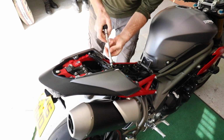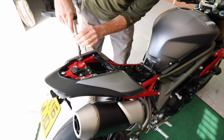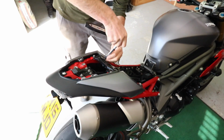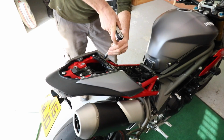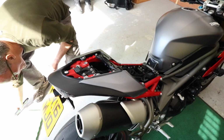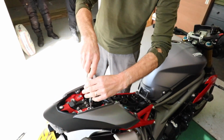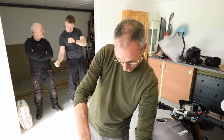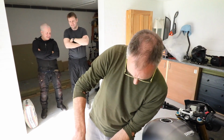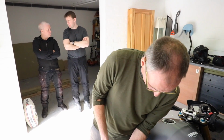If that's still recording, remember, do not over tighten nuts and bolts on your plastic. We've all been guilty of it, I've done it for years, but when you actually read the torque settings you realise you're generally winding these bolts up way too tight, and then you get that horrible moment where something goes crack, or you've cored out the thread because you've put too much pressure onto the bolts. So just take it easy, just nip them up, you don't need much on them.